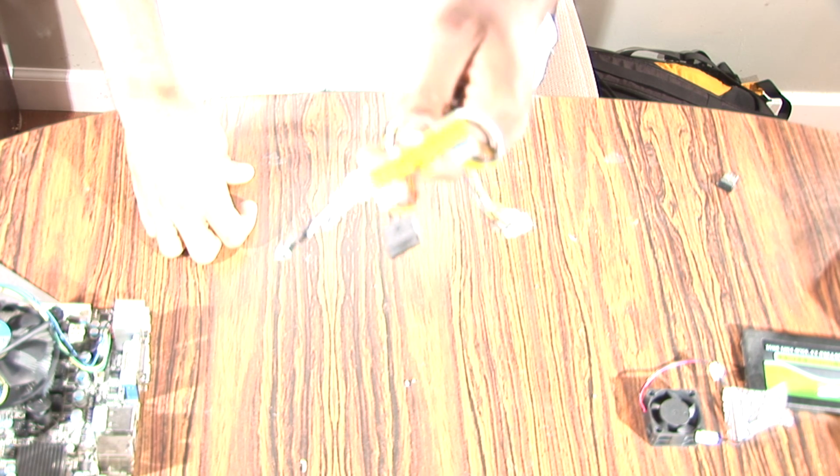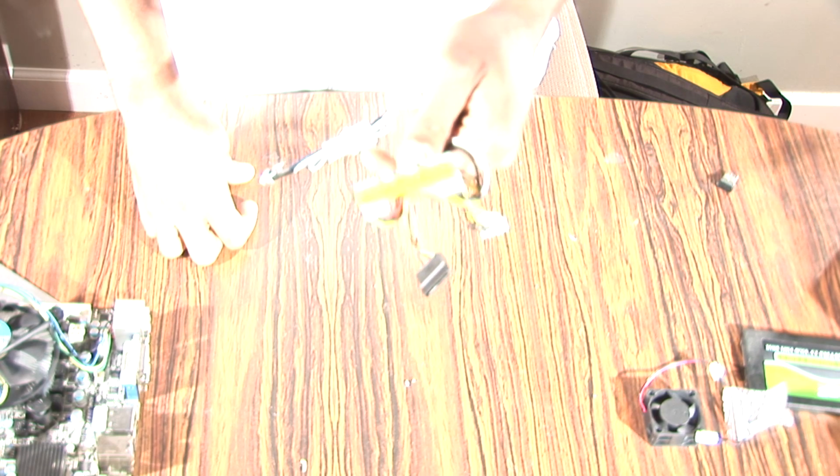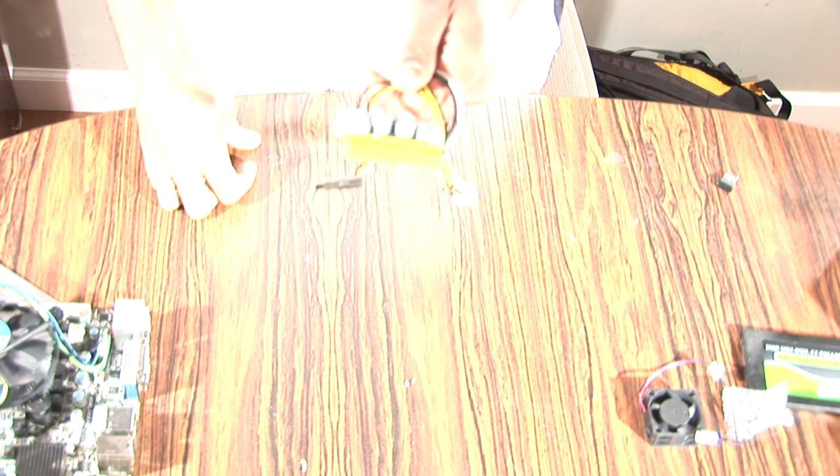And at this point, I'm thinking that the reason why this doesn't work is that the processor that I have, which takes 95 watts, is either too powerful for the power supply or the power cord that I bought. The power cord that I have is basically a laptop cord that I bought off eBay. It looks exactly like the power cord for a laptop, and that is 120 watts. This is 160 watts. The processor I have is 95 watts.